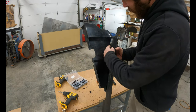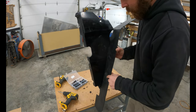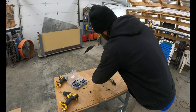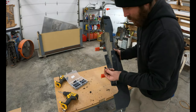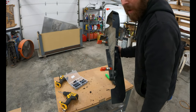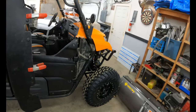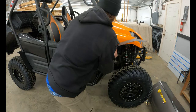I stuck this up there, lined it up with my line that I traced along the contour of this body panel here, and then lined up my two marks that I put between the fender flare and the body panel itself. I put two clamps, one up here and one there, and then drilled three holes. I used these little push-pin body fasteners — these are really handy to have. I think I paid like five bucks for the whole kit at Harbor Freight or Amazon. They're handy because whether you're taking your bike apart or building something like this, those things always break. All set, ready to go back on there.